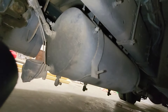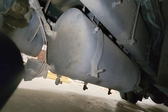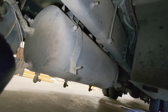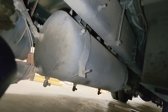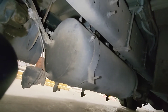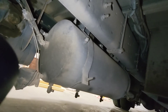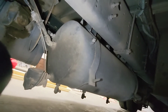I'm going to put down the camera, go get those other fittings, get a wrench and pull these fittings off, get the new fittings ready with some Teflon tape. Because I am crawling and working underneath the bus, right now this bus has zero air pressure in it. So the suspension is already as low as it's going to go and the air brakes are engaged — it is safe to be crawling underneath. The air tanks are drained down to nothing, so I don't have to worry about the suspension falling on me. The mechanical spring-loaded parking brakes are engaged, so this bus is not moving and it's safe to work under here.